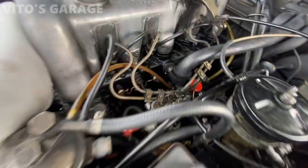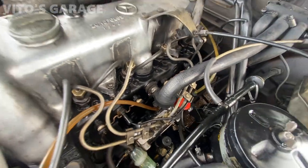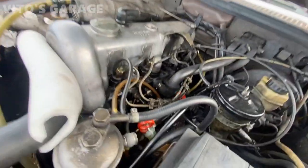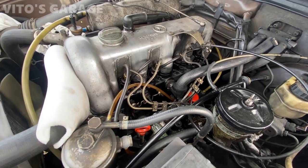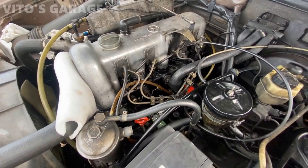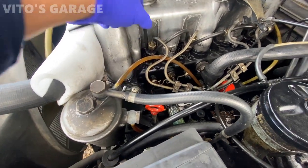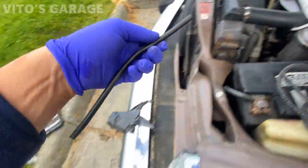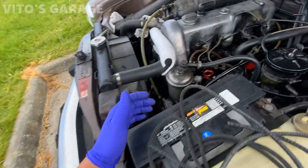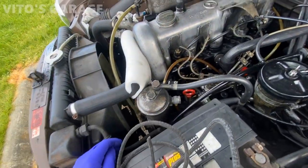Okay, so everything's been amazing — no fuel leaks from the fuel delivery valves anymore. Everything is great. Now what I really want to do is replace these fuel return hoses. I don't really like these silicone or vacuum hose style ones. Look at how easy this hose is to take off — it shouldn't be this easy. This is literally the wrong hose type installed on here. It's supposed to be this style here, so I'm going to be cutting it to length one by one and replacing them.